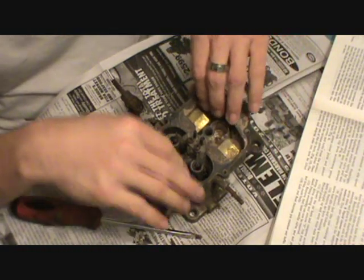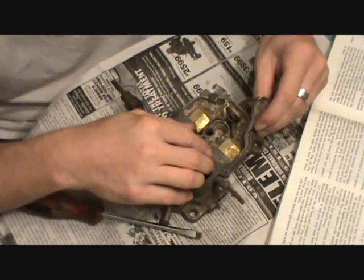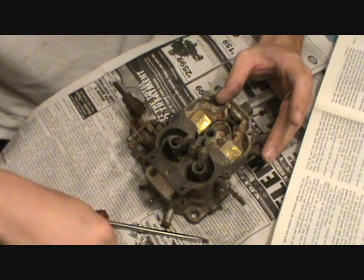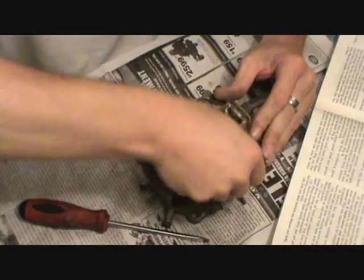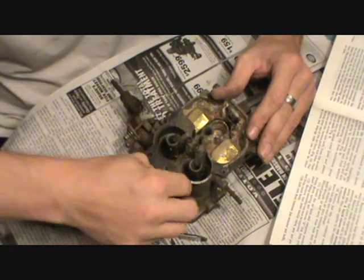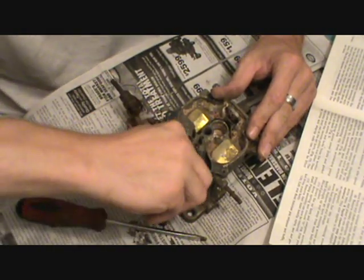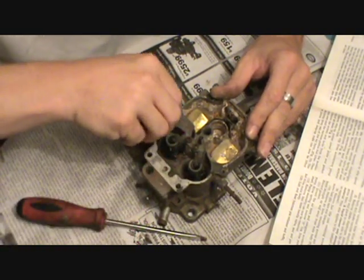And then you have a gasket here. This thing's dirty — it's got all kinds of rust in it. Well, we'll fix that, we'll soon take care of that. Now I'm just kind of peeling this air horn gasket off, but you need to come back through after you soak it. That soaking stuff is pretty harsh and it kind of tends to get this softened up a little bit. You may have to come back with a scraper blade or whatever and get the remains of it off.